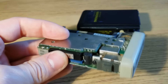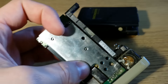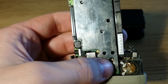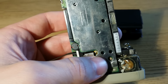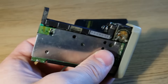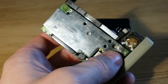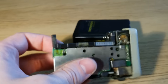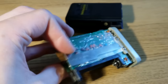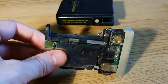Just without taking these boards apart I can see that whoever designed this used every possible available bit of space. They've even made holes in the PCB and shielding so this could be configured and tuned to whatever frequency it was going to be used on. Here in the UK it was 800 or 900 megahertz, but if this was sold in other countries they might need to change that — that's why you've got these small trim pots accessible just by taking the casing off. Also, although this is marketed by British Telecom, it was actually designed by Panasonic, just customised by BT to have their logo on the casing.